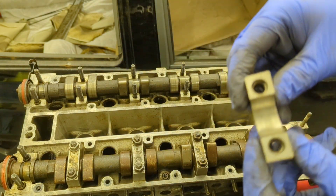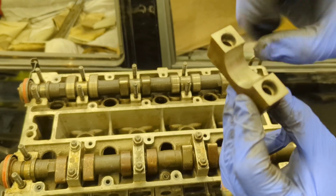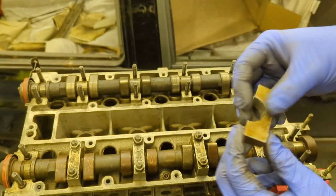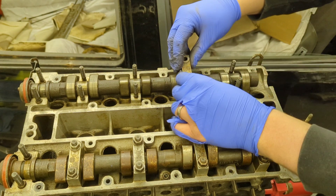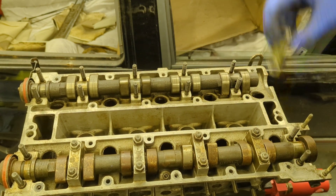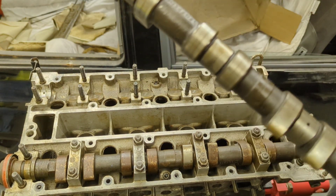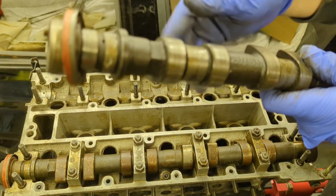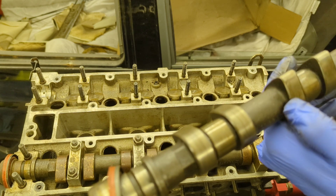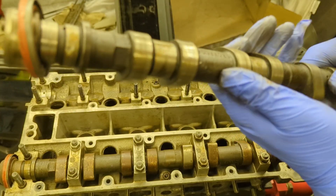With the caps off, the tappets are in pretty good condition — a little bit of very minor marks but not proper scores, just slight marks. Cams look in good condition too. That's the inlet cam, and I have no idea if it's an XC inlet cam or a LET one. We'll need to do some research and measuring, because the LET cam has one millimetre bigger lobes.